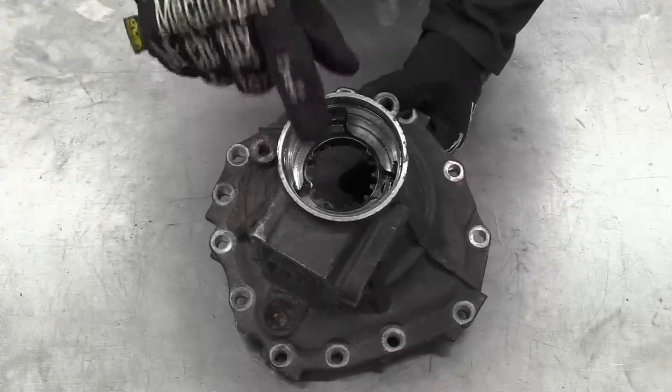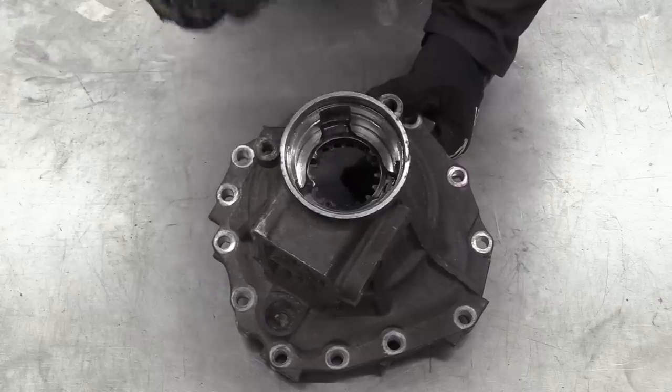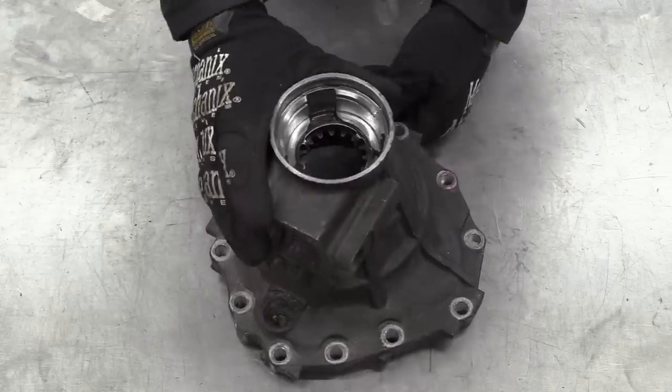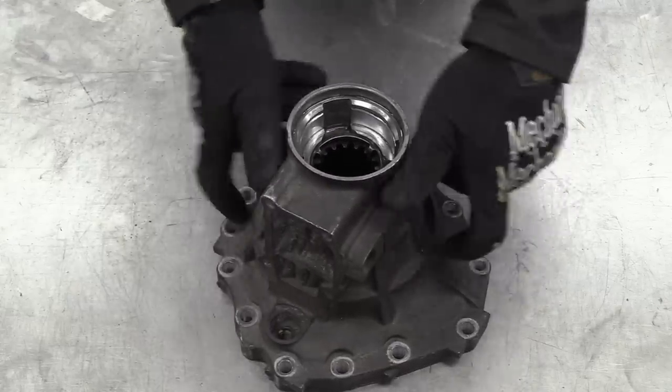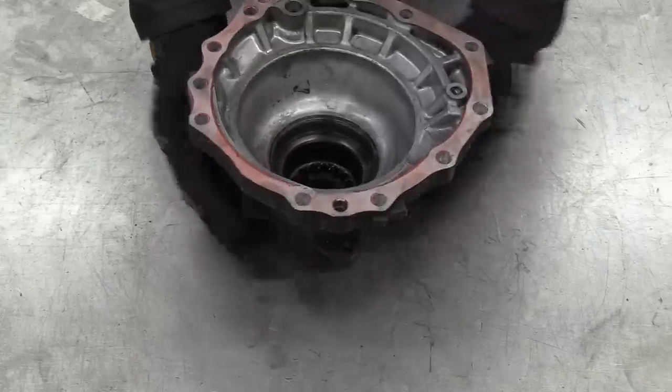There's a screw adjuster and a lock ring down there to put the preload on the bearing. If you wanted to change the bearing, you'd have to take those out and then thrash it out. We've absolutely no need to, so we can call that casing good. The bearing race is well down in there and protected, and it can't get any crap behind it.